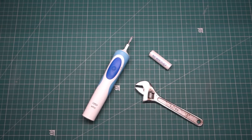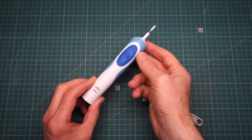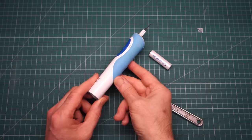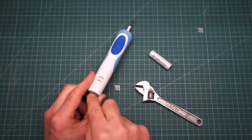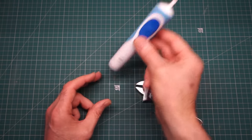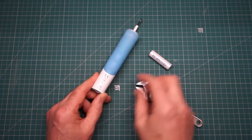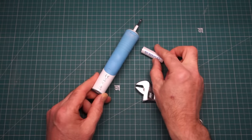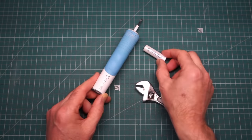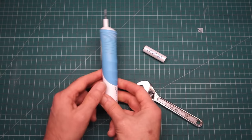Hello there and welcome to another Power On episode. Today is hopefully a fairly simple repair. I've got this Braun Oral-B electric toothbrush, probably about four or five years old. It runs off a rechargeable battery and sits on its cradle with an inductive charging unit at the bottom. I'm getting only one or two days usage out of it before it has to go back on the cradle, so I'm wondering whether the nickel cadmium battery can be replaced with a bog-standard Eneloop nickel metal hydride. We shouldn't have any problems with the charging — the current going into the battery through the inductive loop is very small, and the voltages have pretty much the same charging and discharging characteristics for a low current device like this.